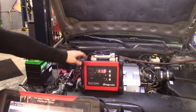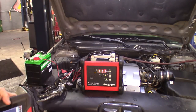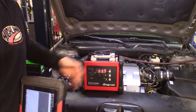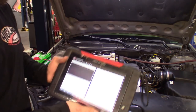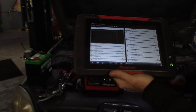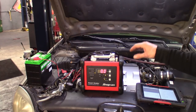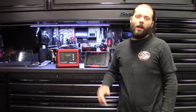It's showing 11 — obviously more pressure is going to be coming from the machine side than by the tank. Quick and easy way to check your pressure sensor and co-witness the readings you're getting from the scanner to the readings on the digital gauge. Yes, they're not perfectly accurate — there's going to be more pressure up front where the hose is than in the back by the tank — but you can clearly see we got a range. We'll turn this thing off, vent it, and we can see it drop as pressure releases, pretty much dropping to normal pressure.